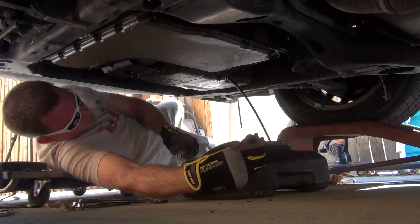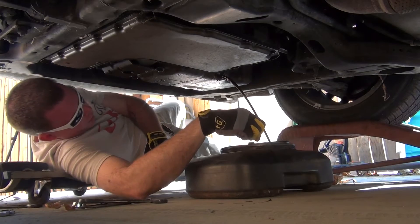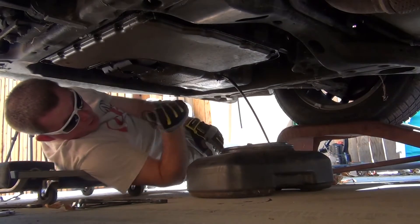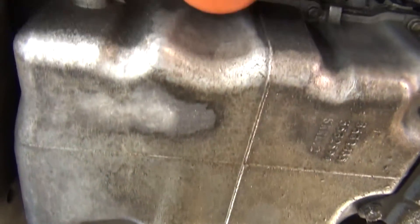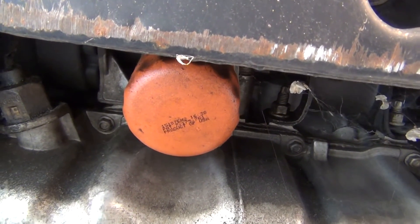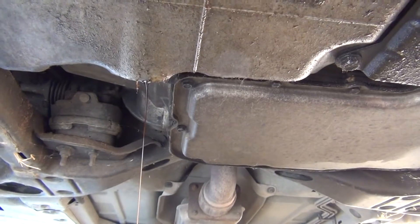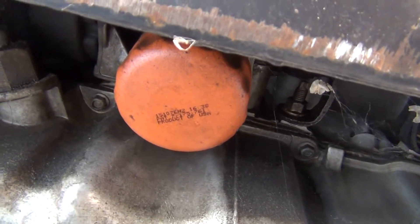That was pretty smooth. We're just going to let that oil drain into the oil catcher and then move on to the next part. While that's draining, if you look up just in front of that towards the front of the car, you can see the oil filter right here. We've got to unscrew that and get it down as well. We'll wait for this to drain first so we can put the bolt back in — that way oil's not leaking everywhere, because when you pull the filter off, oil's going to come out of that too.